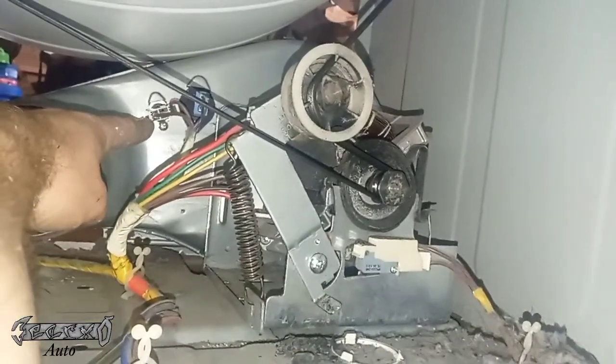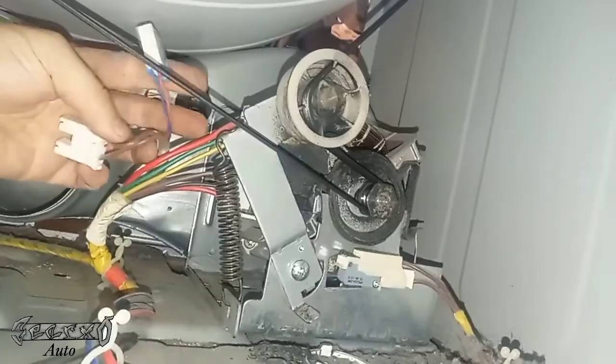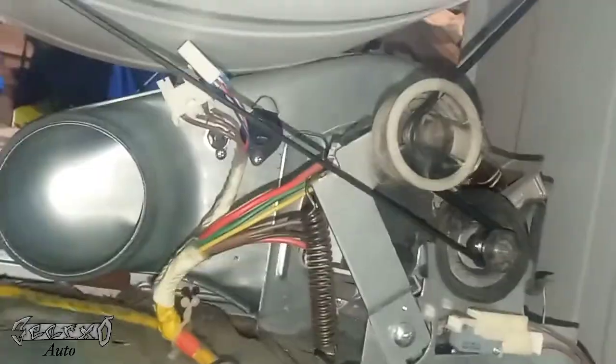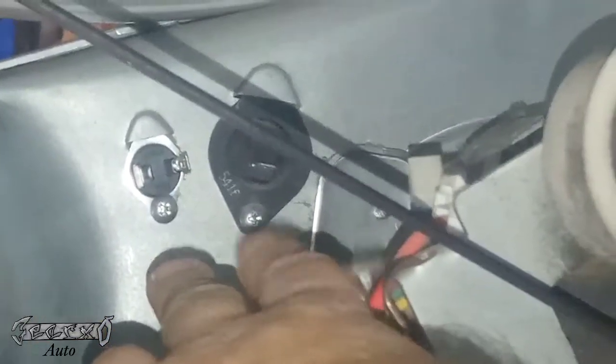To access these, take the back off — there's just a pipe with one screw. Take out that screw and pull the pipe out. These parts are located right here on the back of the blower. The white one is the thermal fuse and the blue one is the thermistor. They're each only held in by a Phillips screw — unscrew them, pull them out, put your new ones in, put the screw back in, and plug them back in.